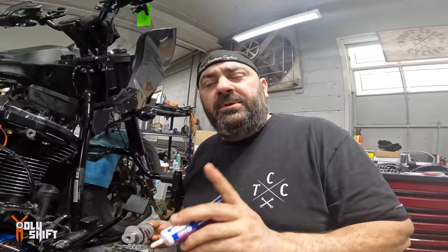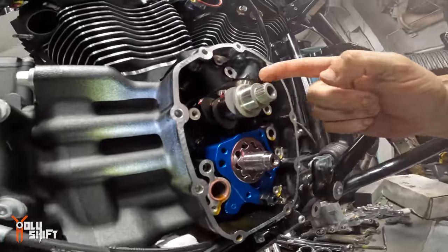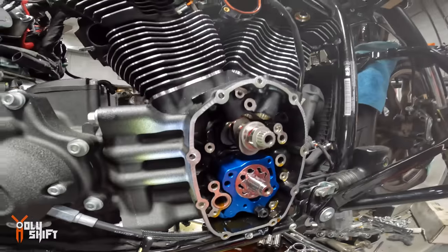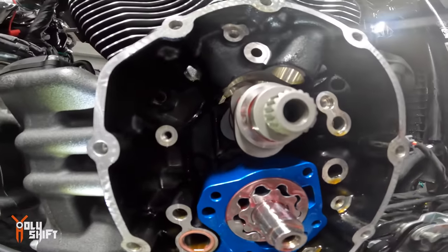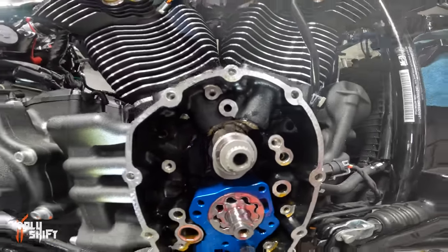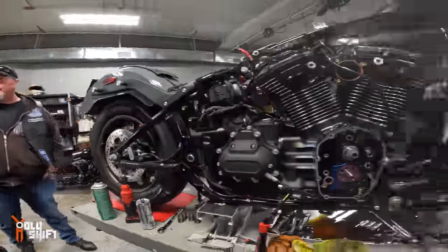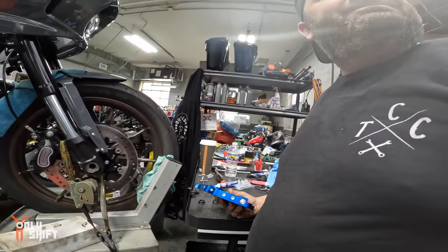Very important though, don't drop the cam. I lube up this last lobe here when it's in already, so I don't drop the cam. You know from experience, you're saying, right? If you drop that, of course. Even if it doesn't crack, it gets... My buddy was going to put a camshaft in his V8, and it slipped out of his hands and dropped on the ground, and it broke into three pieces. Wow. Now, if you drop the cam, the runout might be the same as your crankshaft.